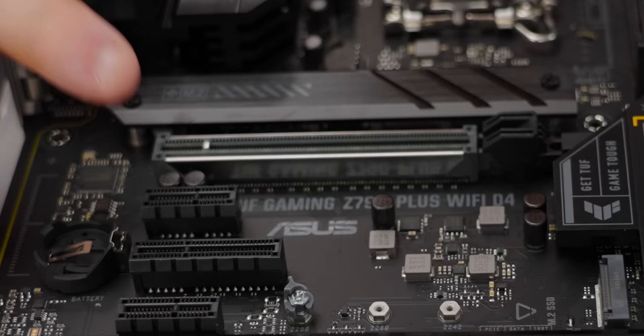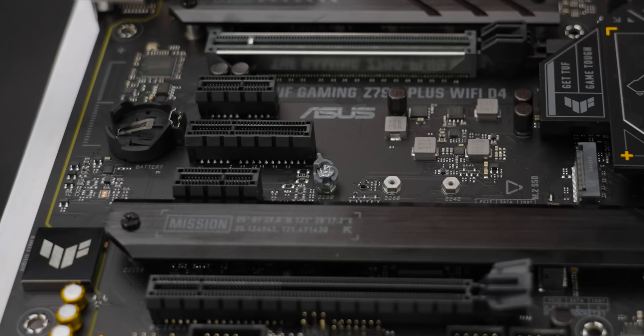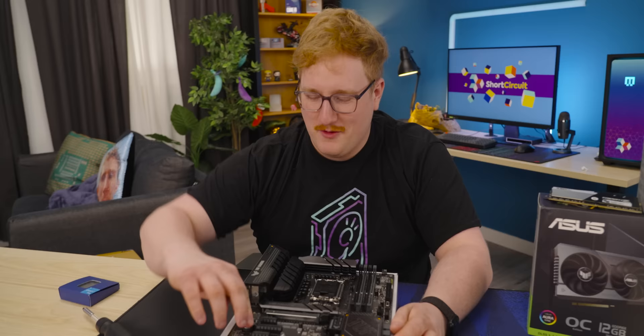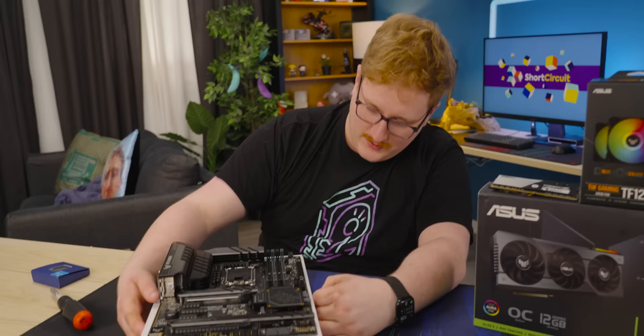On the board itself — this board's got PCIe Gen 5. We've got a Gen 5 x16 slot at the top for a GPU, a 1x slot here, another 1x, another 4x, and then one that looks like a 16 but is actually electrically a 4. There's no CMOS battery in this motherboard. We found the only CMOS battery in the bin is Sunbeam brand, and I don't know how old it is or if it works, so hopefully it does. If it doesn't post, that's going to be the first place I look. There's also a USB 3.2 front panel header, which is a nice inclusion.